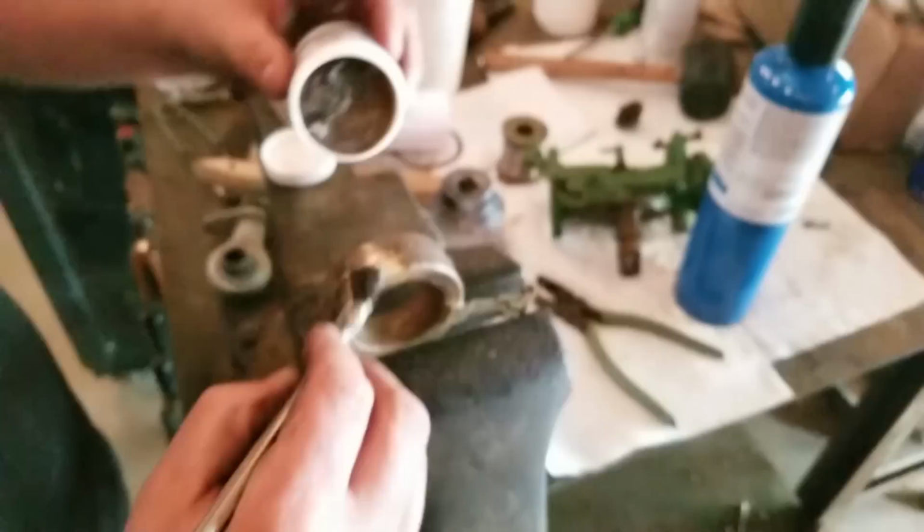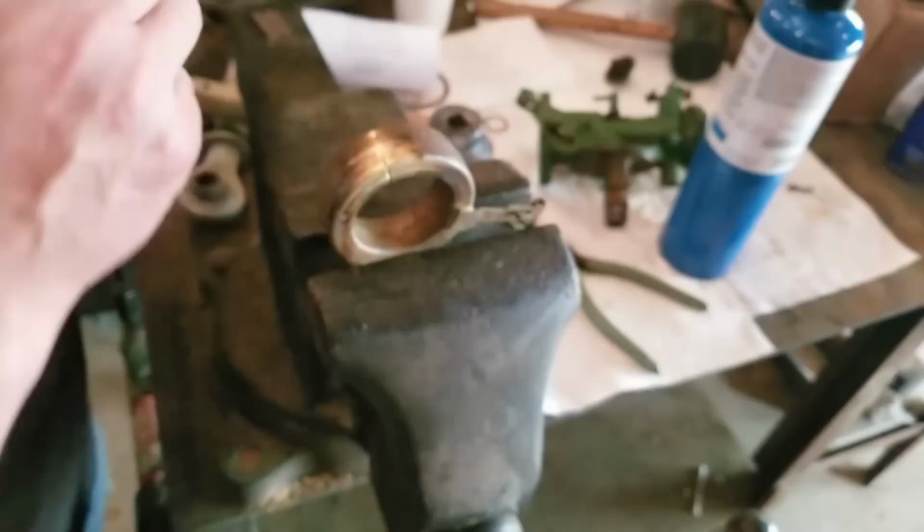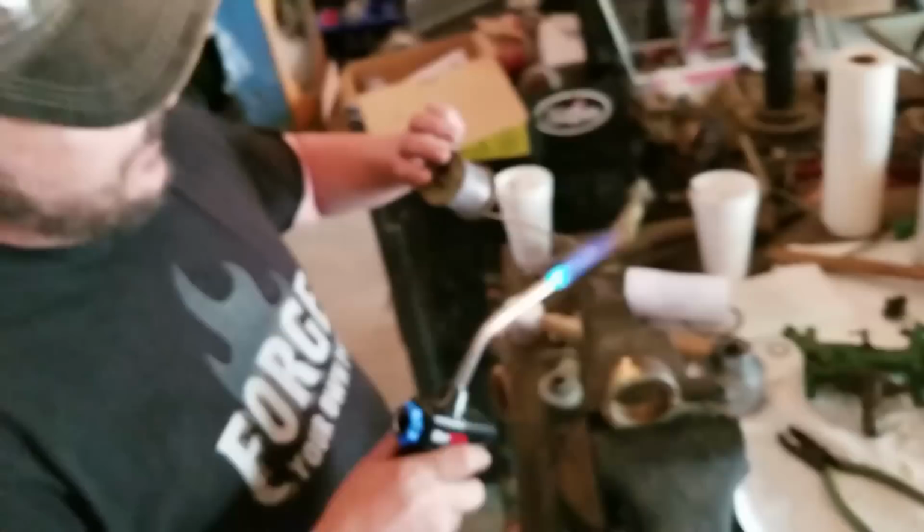The key is you've got to use the right amount of flux. Now, you heat the whole part up and dump it in the flux. We're actually using the wrong one. I was tempted to tin it, which we may end up having to do, and this may fail regardless. And we may end up having to use epoxy. So we got some solder there, special lead base.